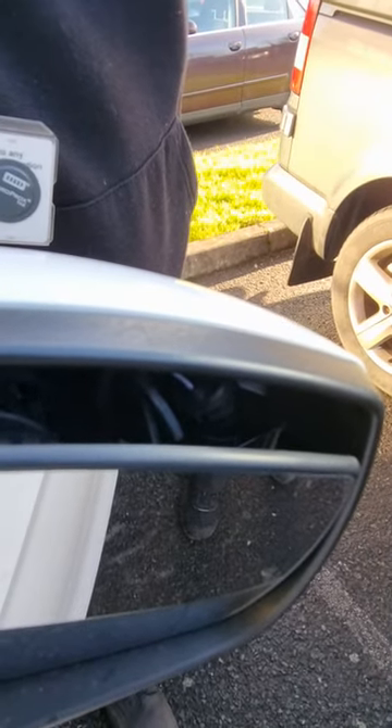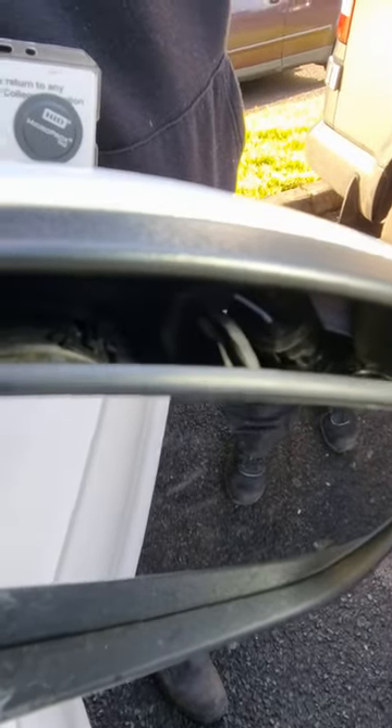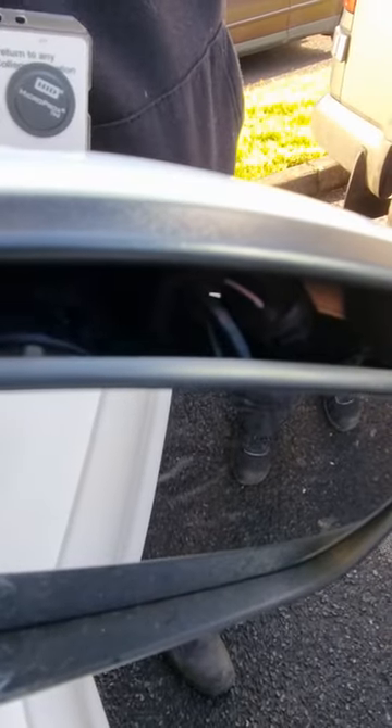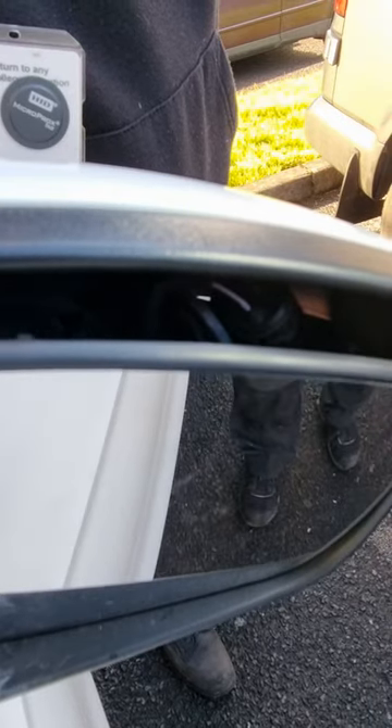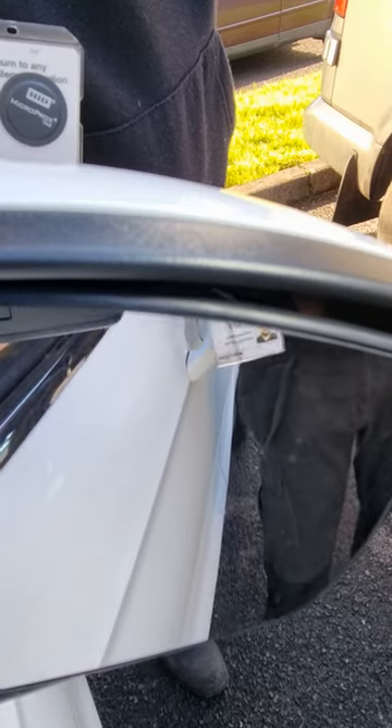No twisting lock or anything on it. And that's the wee bulb holder right in there. Then just reset your mirror back to position and adjust it back for the customer and yourself. And that will be done.